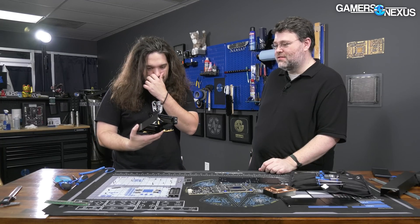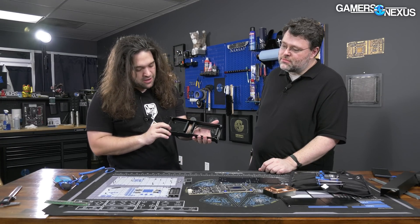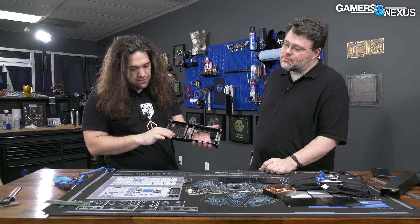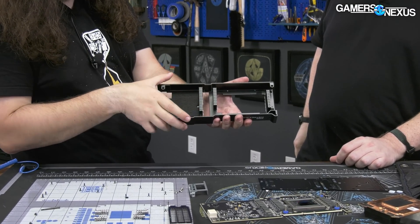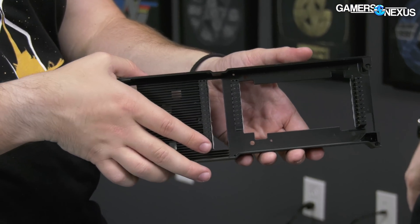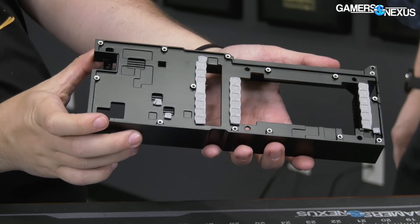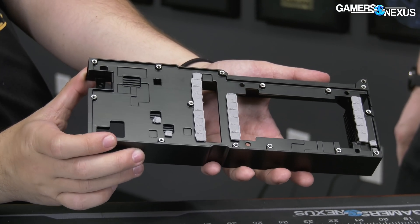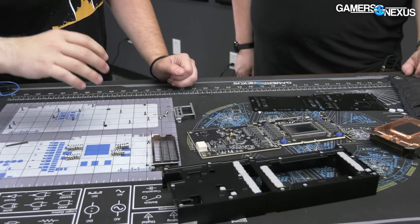The supercomputer people are very happy with this compute architecture from what I understand. Here's the rest of it — there's not much to talk about here, but some fins for heat dissipation across the right half of the board, with larger fins for VRM components. On the backside, there are some 1mm thermal pads that just sit on all the MOSFETs basically. Really simple stuff.